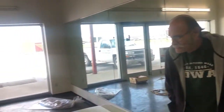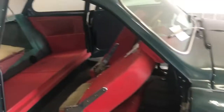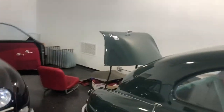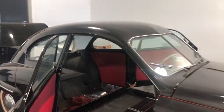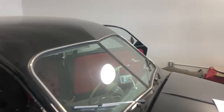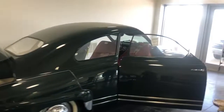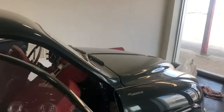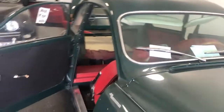Keep your hands clean, take it easy. This last one took us about two hours to get in start to finish, and this one was a little over two hours. This one actually dropped in a little easier because we have more room to get to the clip up here on a split windshield than we do on a non-split. Again, I'd almost bend that edge just enough so you can get in there with a tool and work it, because it's pretty darn tight.